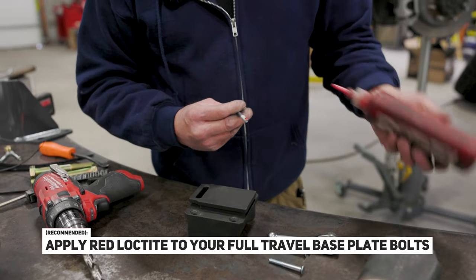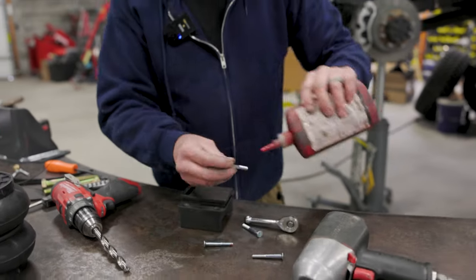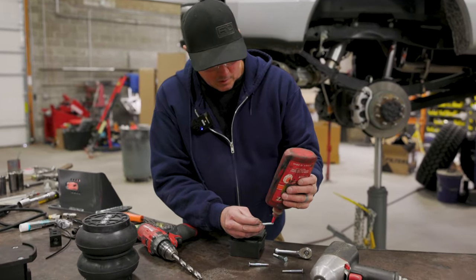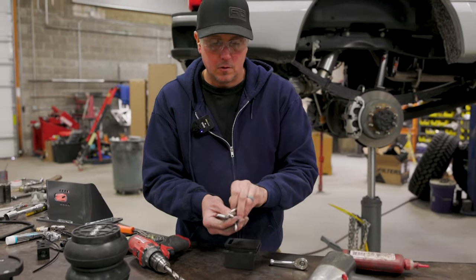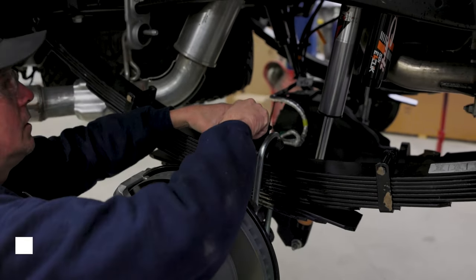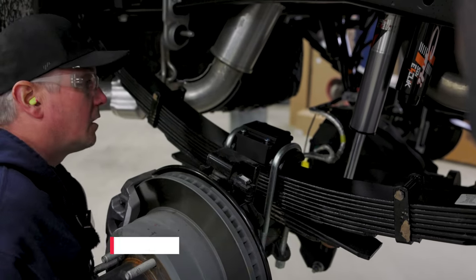This is the base plate that goes with this kit. It's sort of the part that stays on the truck whether you're running the landing pad or not. It just uses some pretty small allen head bolts — you can't really reef on these things too hard, so they suggest throwing a little bit of Loctite on them. The instructions have you put the notch in this base plate towards the rear of the vehicle, and run these down so they're good and tight, but remember they're small bolts so you don't need to get after it too hard.